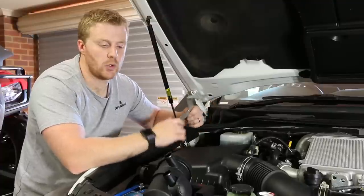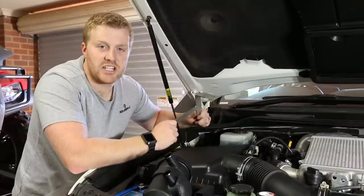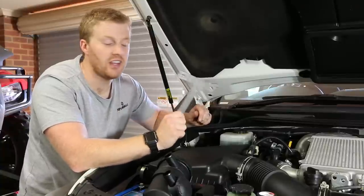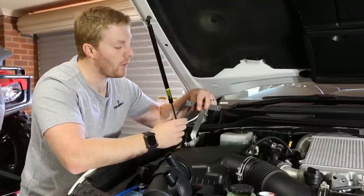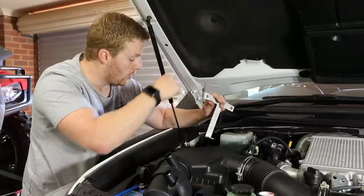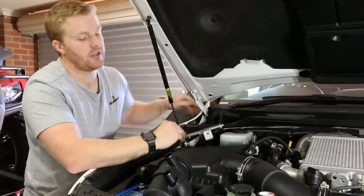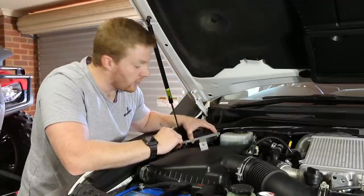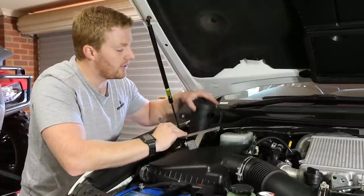Let's start with a step-by-step installation guide for the 200 series. The first thing you need is the bracket from Western Filters, which fits into the back left corner of the 200 series engine bay. One bolt reuses the one holding the horn bracket, and one is supplied in the hardware kit which bolts down into a pre-threaded hole just above the wheel arch. Once the bracket is in, we'll install the can down onto it. It's going to be fairly tight down there so we'll follow the instructions to get the right order and make it easy.